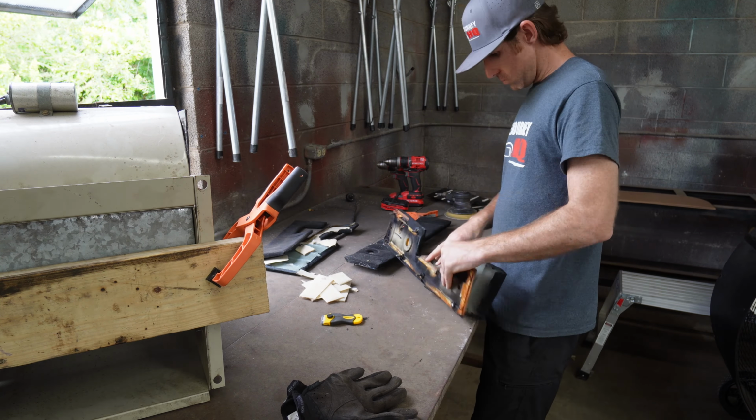Now we got to drop it out, pull these cross members, drop the whole thing out, weld it up. Put it back in for the last time. You gonna take it off at the bands up there? Yes sir. Taking the whole exhaust out? Yes sir. Because it all comes apart at the band at the end of the headers. Yeah, for sure. All right, well, I'll help you do that. I'm gonna need your help. That's what I said, I'll help you do it.